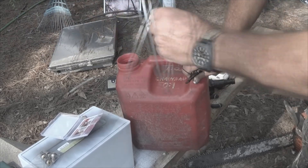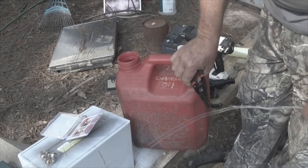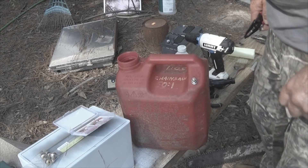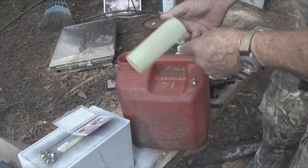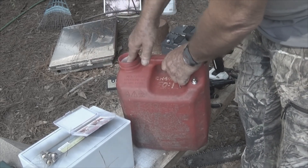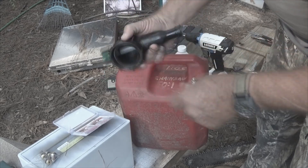We take this back in, put the end of it off, pull this out, cap it — and we are good. We now have a pressure relief. If you notice this has little wings — that's what was keeping it from coming out. Put this back in, screw this back on, check the O-ring, make sure the O-ring is good.